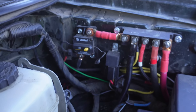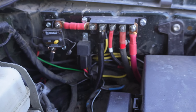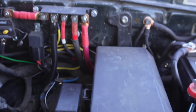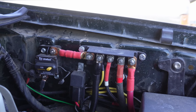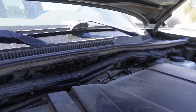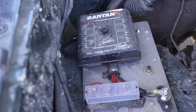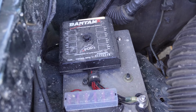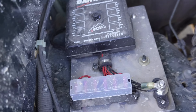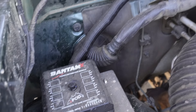Moving under the hood, I kept it as simple as I could. I replaced the fuses for the ARB compressor with a breaker and put a distribution block where I ran a line from the battery — that's also where our winch hooks up. Moving to the passenger side of the engine bay, there's a wire loom running over to the S-Pod and the fuses for the KC rock lights. I made a little plate that bolts to three studs sticking out of the body — it's removable, easy to work on, and nice and tidy.